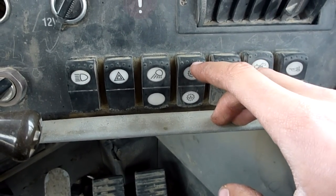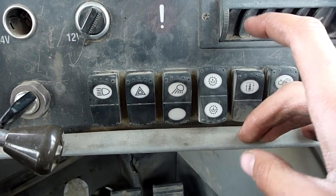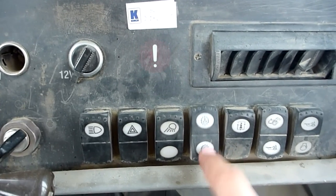This is an important one: in case you lose your back engine, you can kick the rear tranny into neutral and drag around with the front engine and not screw up the transmission. If you don't do that, you will screw up the transmission.